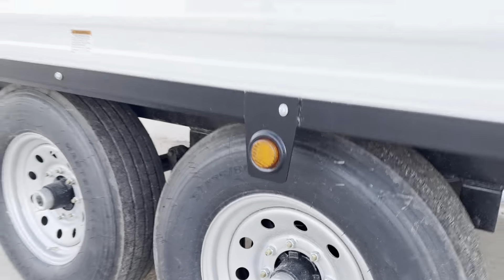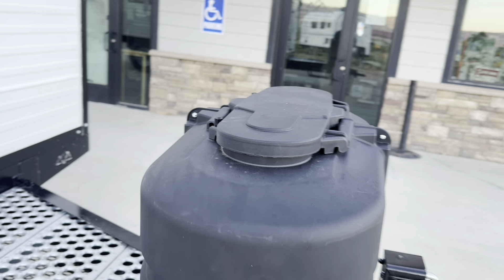It's set up on a tandem style. A lot of these more agriculturally used camps we'll do in a wagon style. The tandems do pull a lot better at freeway speeds than the wagon style, just due to tongue weight — there's virtually no tongue weight on the wagon style ones. I construct all of our camps the same whether you get an S model, meaning a narrower model with an 88 inch interior, or a 96 inch interior. They're all built to the same standard and quality.